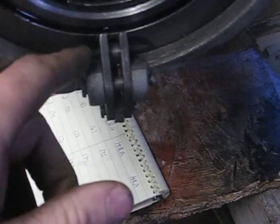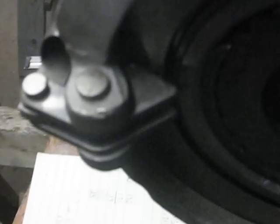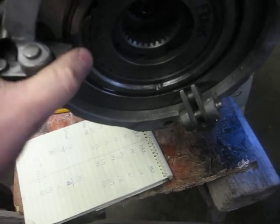One more thing to note: this right here is the Belleville spring washer that actually applies the clutch pack. There's a roller inside there that rides on a ramp, and those ramps wear down. A lot of times when it kicks out - you put it in high range or low range, let go of the lever, and it kicks back out - that's what you're running into: that roller has worn into that ramp. If you take that apart, take it to a machinist and fill it back in, have it machined back down - a lot of times that will take care of it.